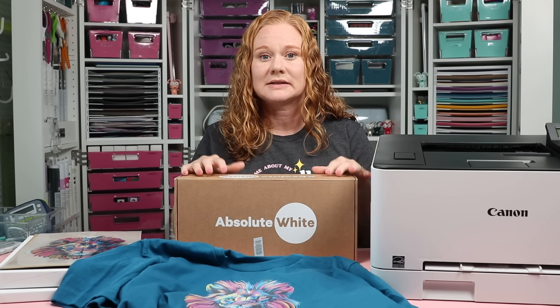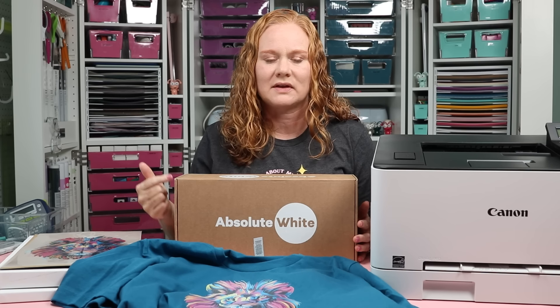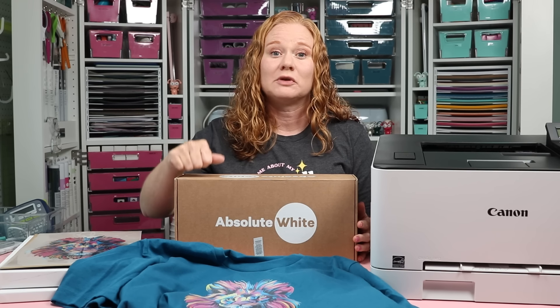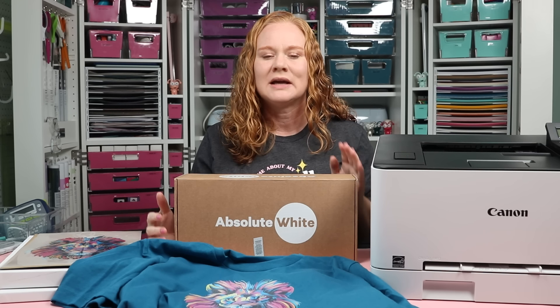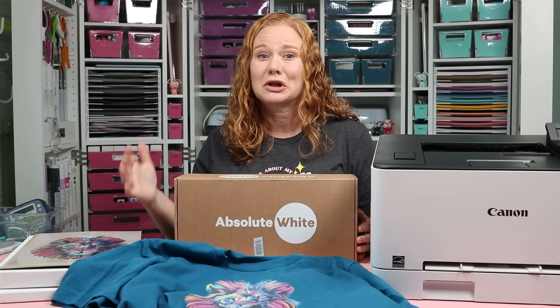The first thing you need to understand is that this cartridge will come with a software license key. There is software that goes with this because it is going to take your image and divide it up into sections. You're going to print twice with this cartridge — once with color and then once with the white installed. You're going to remove the black from this printer and add the white when you're ready to print that white layer. The process of changing the cartridges out is very simple. This is sort of like a printer conversion — we're converting it to be able to print with white. With any printer conversion you often have to do a few extra steps: change the cartridge out, print twice, and that means you can have alignment issues with your print.